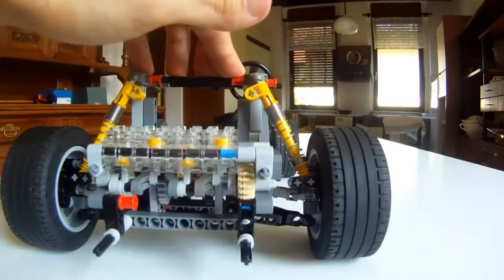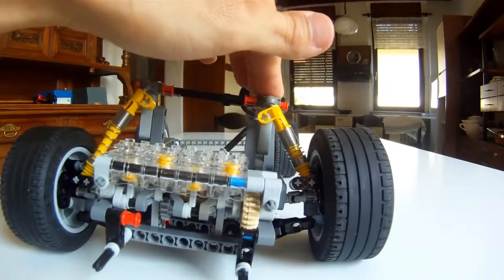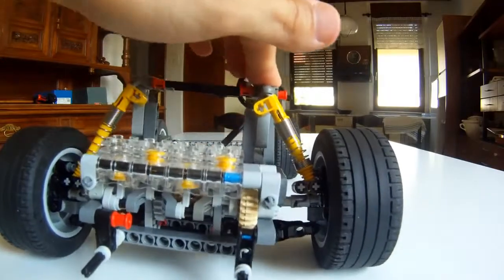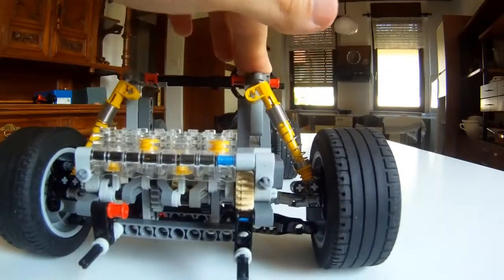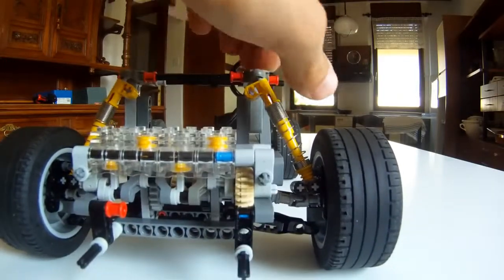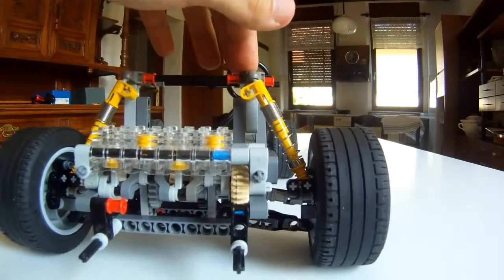When observing how the suspension works, we see that this time the camber angle of the wheel does change when only one side of the vehicle gets compressed. This is something that unequal length wishbones solved, but here we do not have that luxury. A small trade-off for simplicity. It's my favorite type of suspension because of its directness and compactness.